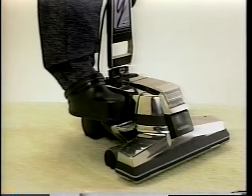Also, slides with the centering spring require the use of a transmission manufactured since November of 1992 or later. The first five digits of the serial number located on the barcode label at the base of the transmission should read 19211 or after.